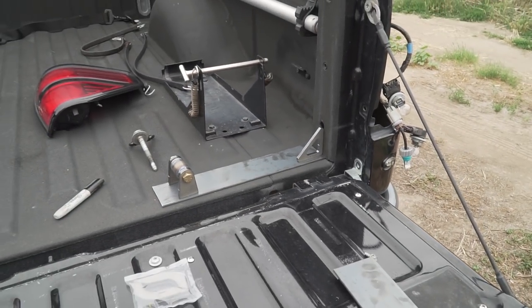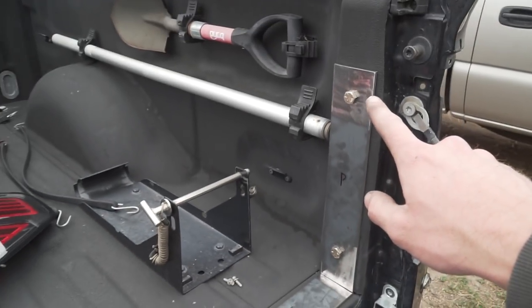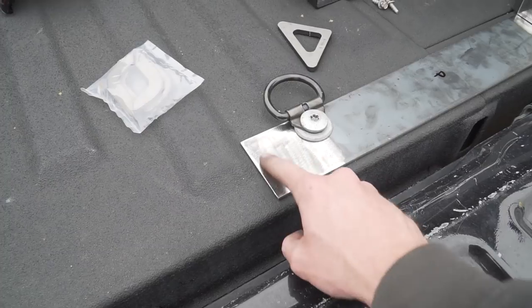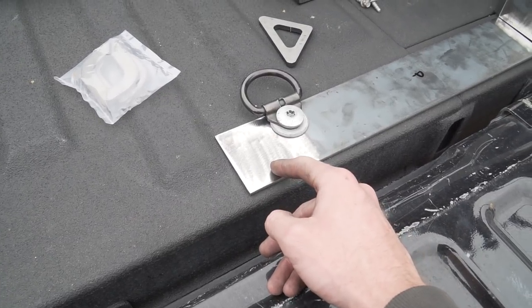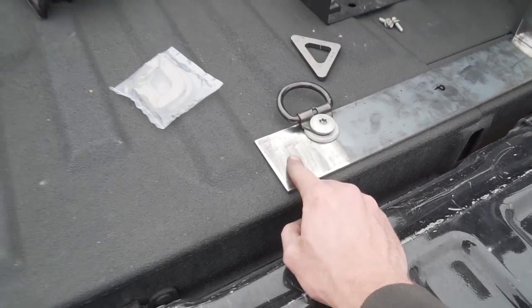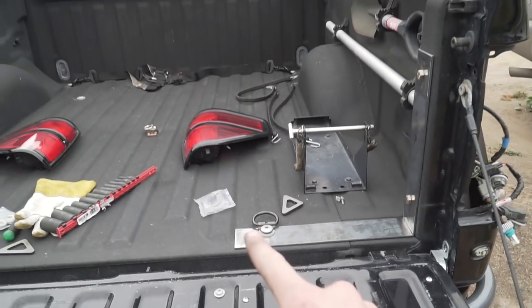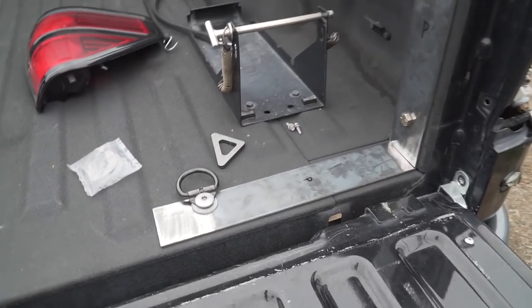I'll connect from here to there with the inch-and-a-quarter tubing and throw our gussets in here and get all that tacked together, then I'll pull everything off and weld it off the truck. I went ahead and marked and drilled all the holes off camera and got the plates prepped for welding. I ended up remaking the bottom plates and made them a little bit longer because I want the tab assembly to sit outside of the bed bolt. Before, the plate ended right here and it just didn't look good — so I remade these so the tab assembly sits back further, which will look a lot better. I do need to pull the truck back under the carport to reach everything with the welder.